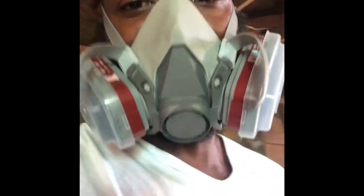All right, so first step, what I did was clean it down real good. After I scuffed it with a scuff pad and just roughed up the vinyl a little bit, and after that, what I did was I wiped it down real good, cleaned it up, and hit it with some prep solvent.